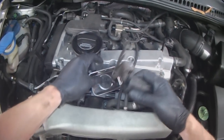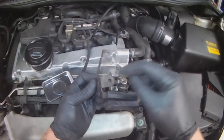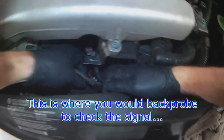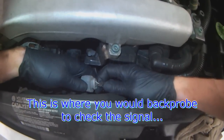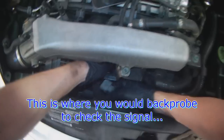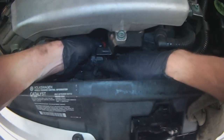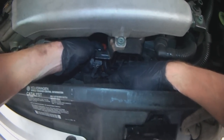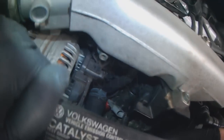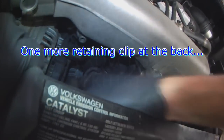Then remove the bracket for a little bit more room — there's a little screw that holds it in place. The alternator wiring harness goes through here, and these two little clips hold the crank sensor loom. You can see there are three wires. Now that it's accessible, you can back-probe if you want to check the signal first — just attach your scope to the two wires and do your signal checking. I already know the signal cuts out, so I'm just going to replace the sensor.